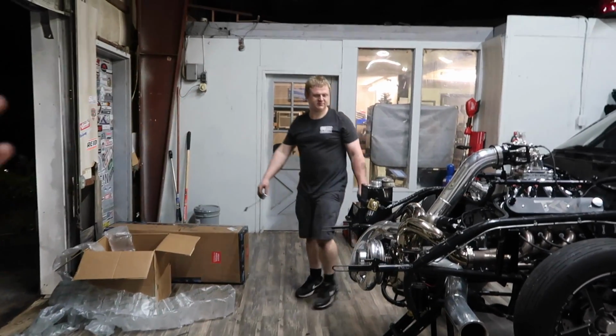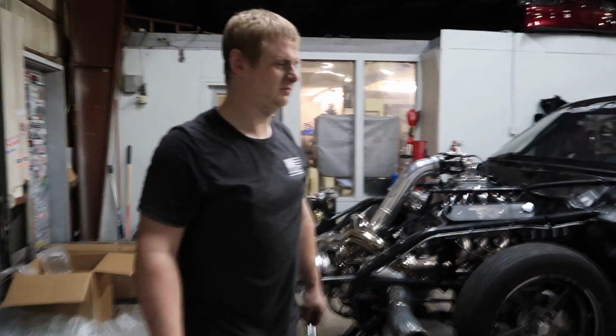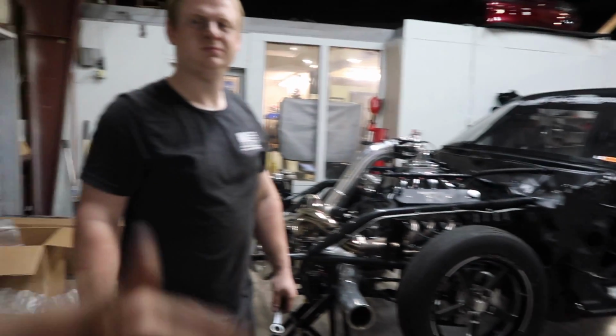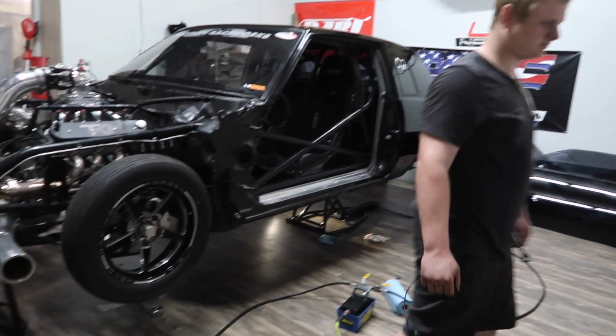It was extending super fast, so we took some anti-squat out of it. We should probably test it on that same shock setting it's at right now and see what it does. I mean, that'd be a good place to start. Generally, if you're going to take some anti-squat out of it, you need to loosen the shock up to get that same rate of separation. But we had too much separation. All these variables are leading us to where we are now.